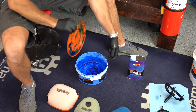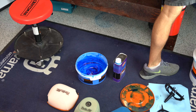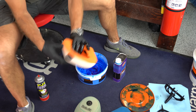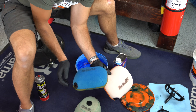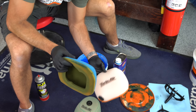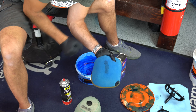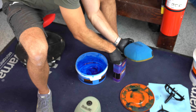There are a couple of ways to apply the oil. Some of you might have oil that's in liquid form like this, and other times you might have a spray where you can literally just spray your filter and get it permeated throughout. You can spray it, then work it together and work it through like this, making sure the oil is spread throughout. What I'm going to do today is slightly different.